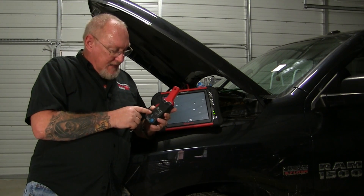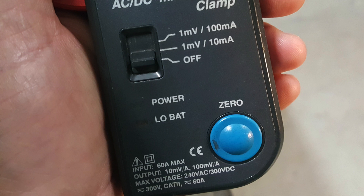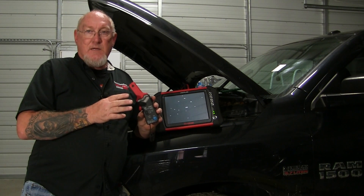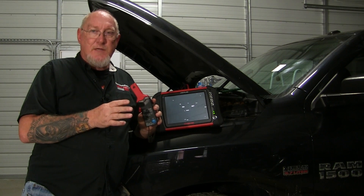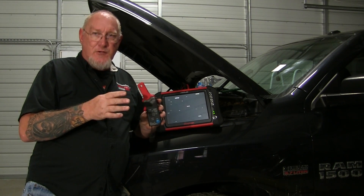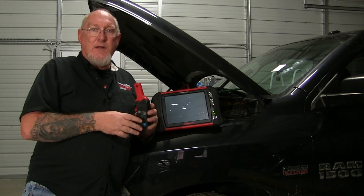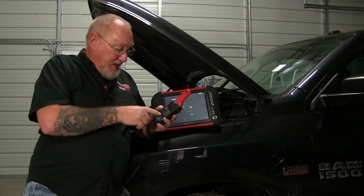On these tools there are generally two scales to choose from — some are listed as either a 20 amp range or 60 amp range. This one has a strict correlation between the millivolts and the milliamps that it's measuring. All scope accessories do one thing: they take whatever form of measurement you're trying to take and convert it to a voltage input that your scope can recognize.